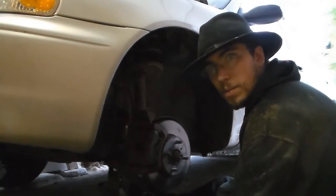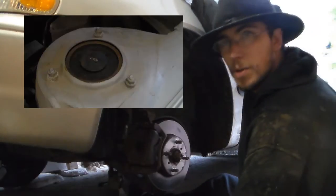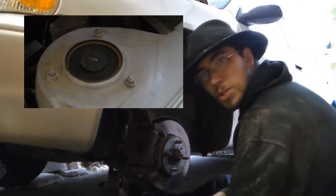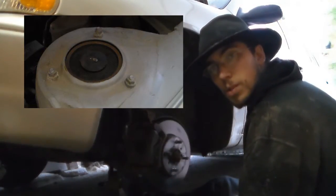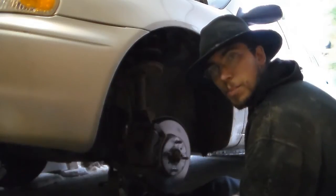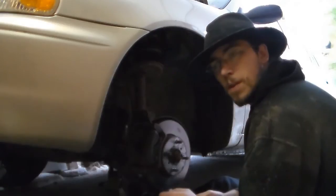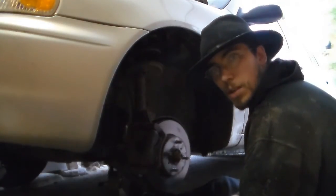After you're done with that, you can take out the nuts that are at the top up here. I'll post up yet another photo. Once you take those out, the whole assembly will drop. At that point, it's a lot nicer to have somebody here, because yet again, you're trying to save from replacing brake hoses. Otherwise than that, pretty much install is the exact opposite.